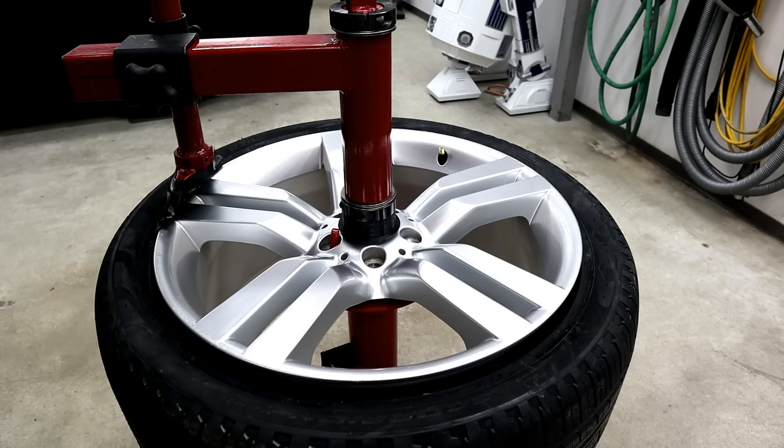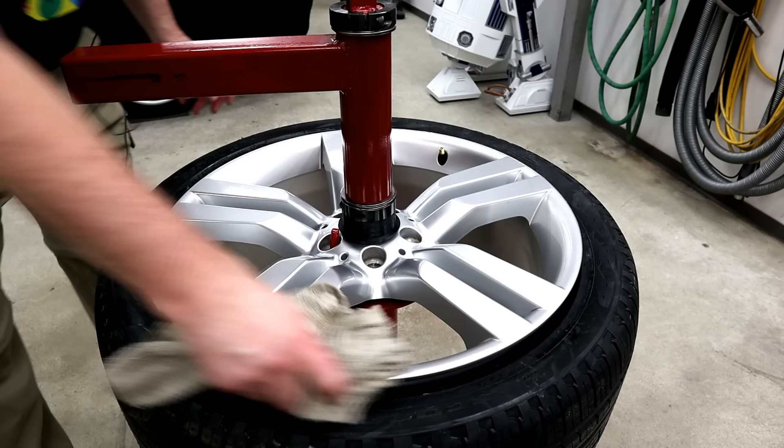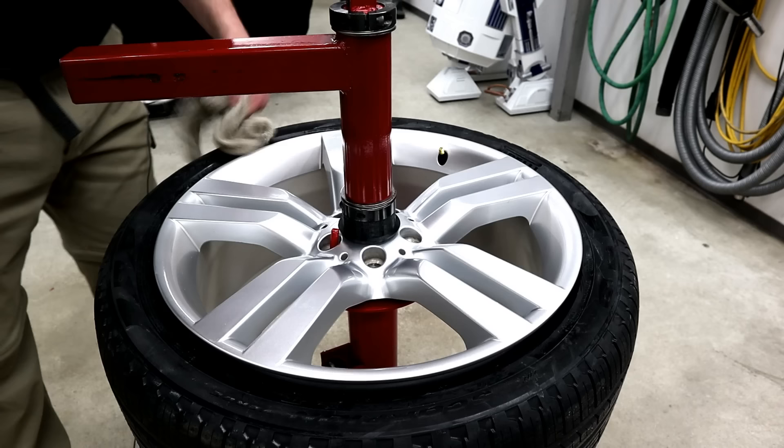You'll find this process is even easier with higher profile tires. These winter 235/55R18s — I don't even need the little bead clamp at all. Just going around, don't even need the bar. They pop on really easy. I'll just take the duck head adapter off and go around with a damp rag at this point, just inspect the wheel. Make sure there are no scratches. Looks absolutely pristine.